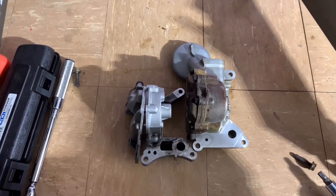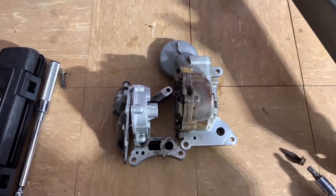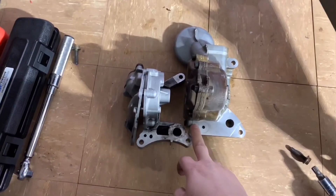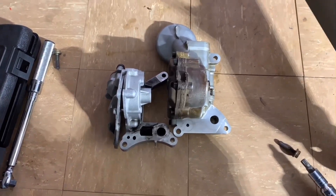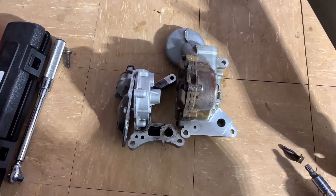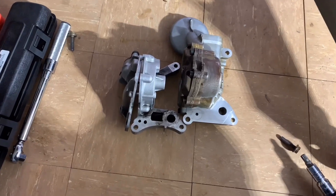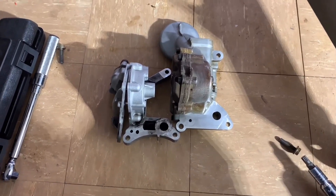I have a picture of the pressure specs and I'll attach it to the video. Without the pressure bleed-off, it should give full pressure — about four or five bar, or even more. I'd like to just keep the full pressure. I'm going to double-check everything, but I'm pretty sure I'm going to keep it the way it is. I'd like to see full pressure at all RPMs, which is a lot better especially for performance cars. If you track your car a lot, you need full circulation and full pressure to the oil cooler to cool off the oil and lubricate all the parts. So yeah, it's a good point. We're good — it's a complete bolt-on swap. See you guys later.